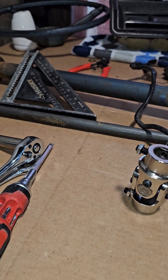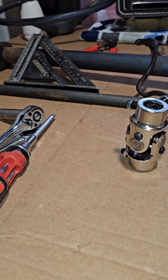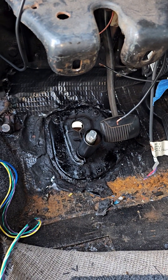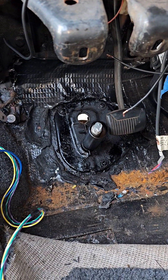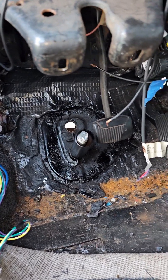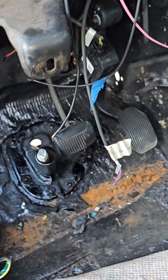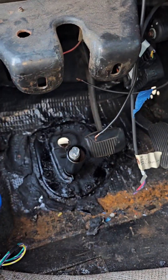I'm going to get this mounted, cut the tube down to fit it, get this part installed, and then figure out what I'm going to do with the top half. Here you can see I got the first part of the shaft installed — you can see the double-D that's cut into it. The next step is to mount the Prius column right here; I'm going to wrap it in a little bit of eighth-inch thick foam just to keep it from scuffing the edges.